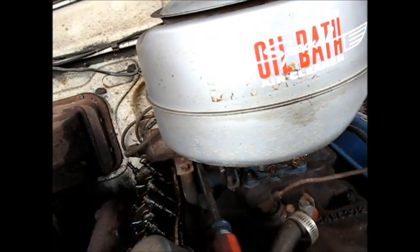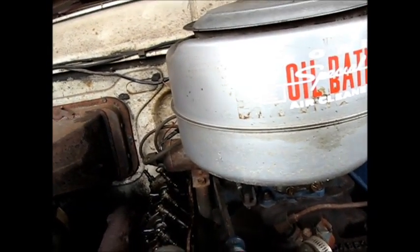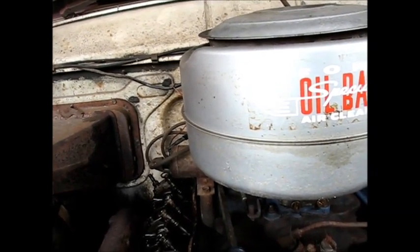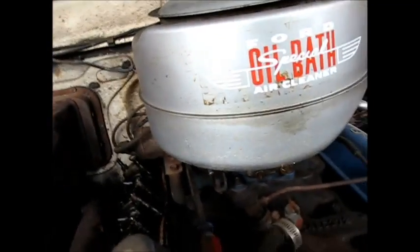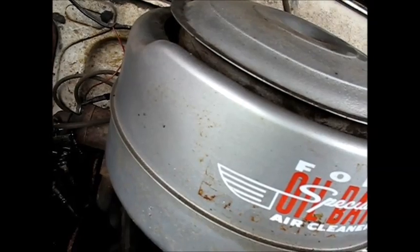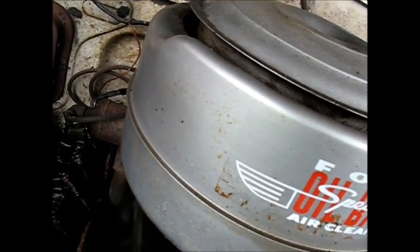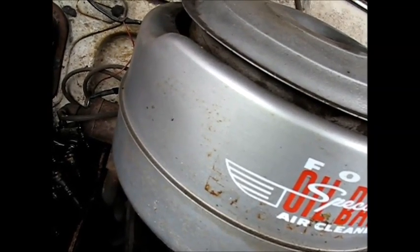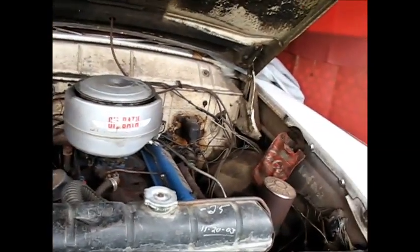There's not one at all right there - that's what that knocking is. If that rod is down in the motor somewhere, who knows what. This thing has solid lifters, I believe, which means to get that rod out the intake manifold has got to come off. It may be that the solid lifter down underneath there collapsed or something like that. This is an opportunity for me to at least spend some time getting to know this old girl. It's not good, but at least I know exactly what the problem is.